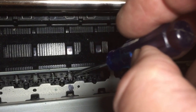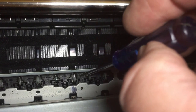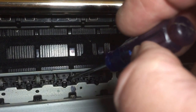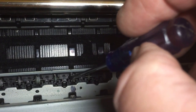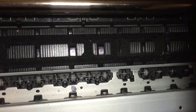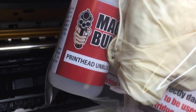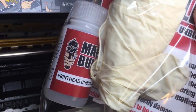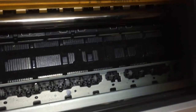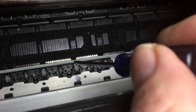The reason these little wheels are causing the mark is that either side there's what looks like a steel axle, but in actual fact that is a spring. What you need to do is get some Magic Bullet cleaner. This fluid actually dissolves the dried ink that has formed on either side of the wheel.